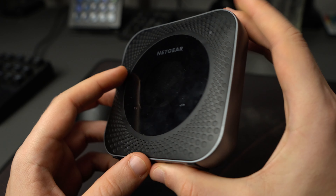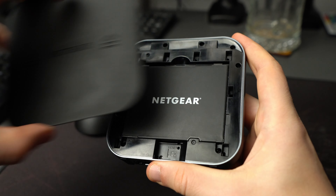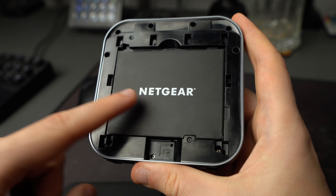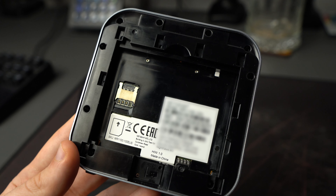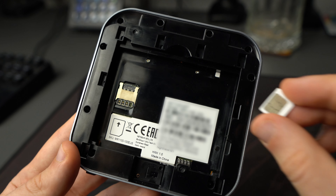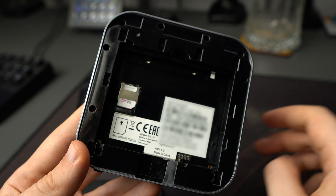Let's start with the hardware side. Flip to the back and remove the back plate. Underneath you'll see the big battery. Unfortunately, the Nighthawk overheats with the battery, so it's basically useless — you can throw it in the bin because you will never use it for IRL streaming or any other streaming purpose. Take a picture of the label on the back because you'll need that info to access the router. Also insert the SIM card you're going to use for streaming — you can use a micro adapter if you have a nano SIM. Then close it up.